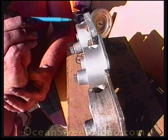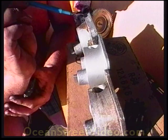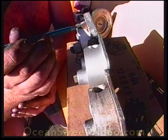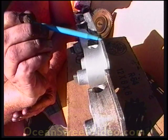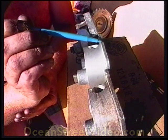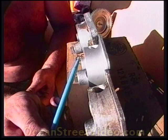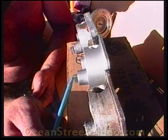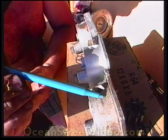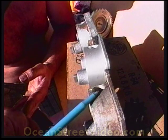This is for an earlier case — a single relief case. It's got a smaller oil hole, a receiver hole right here, and it also has a bigger flange here. It sits at a different depth and is used only on flat cams. This pump here is designed only for dual relief cases and uses a special dished cam. It sits much farther into the case, and because the camshaft is recessed it allows for more gear clearance. This other pump is used for a dual relief case with a flat cam also. The gears are considerably smaller.